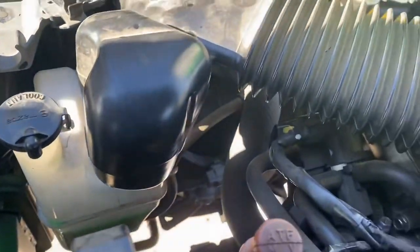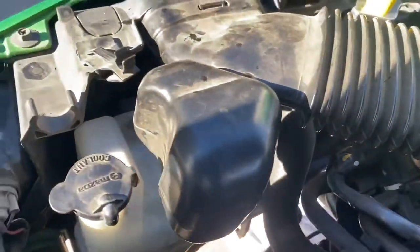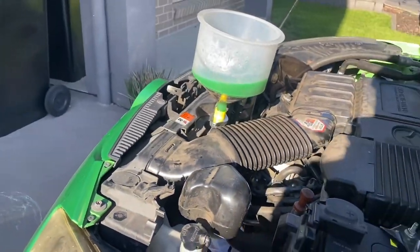Now we can audibly hear and see that the radiator fan has kicked in. We've confirmed that the cooling system is bled and we've bled the system successfully. So there we have it — that's how you change and bleed the cooling system. Don't forget to wait until the radiator fan kicks in before you switch the engine off to confirm the engine's been bled correctly. Make sure the air conditioner is switched off and wait for those fans to turn on to ensure the thermostat is open. If you're unsure whether the thermostat is open, check the top and bottom radiator hoses. Also consult the owner's manual as to what coolant to use and how often you need to be changing it. Thanks for watching — we'll see you next time on Tomo's Tune-Ups, all things DIY and mechanical.